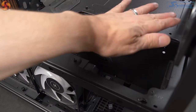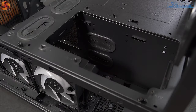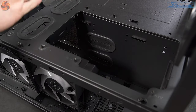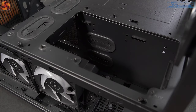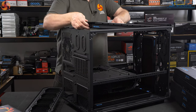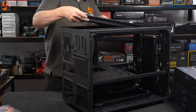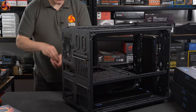That's a 360 rad in the front as well. You'll note the top is not supported and I could add extra screws. Alternatively I could use a 280 in the outer slots, or use the 200mm mounts with Thermaltake's 360mm rad which uses 2×180mm fans — a form factor I haven't seen yet. In the side you can put a 420mm or 480mm. I've put a 360mm crossflow with three fans, using this unusual bracket that only covers two of the three fans. In the top racks I've fitted two 480mm Alphacool radiators, each locked down with thumb screws.